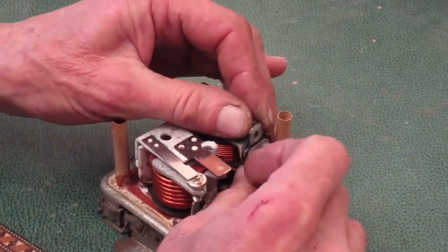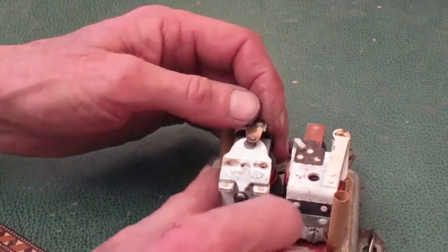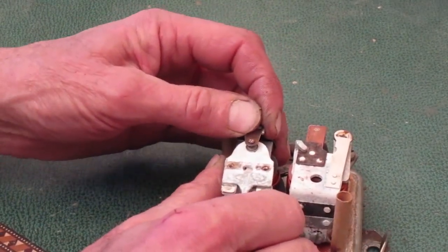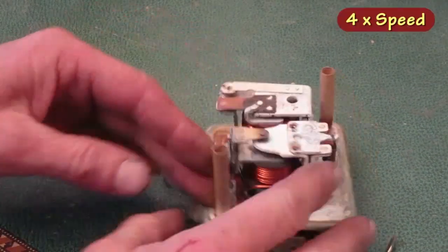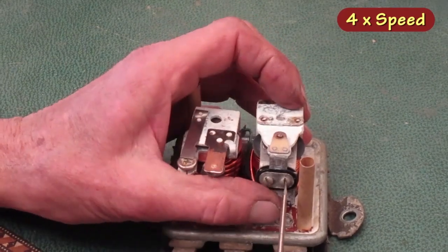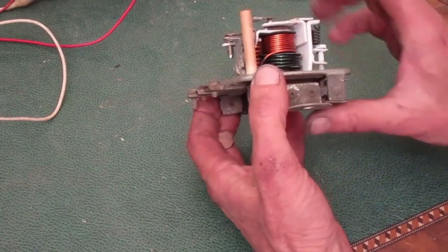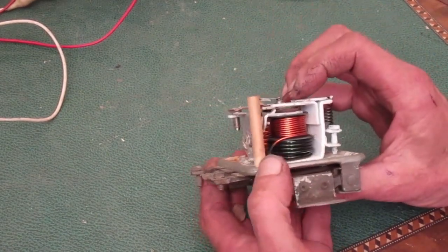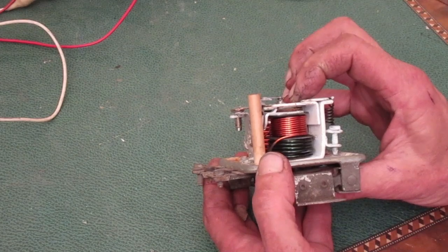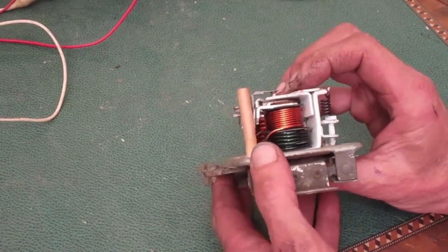This one has slotted mounting holes like the other coil. There's enough room to have it way out of position, so line up the points when you tighten the screws. Now I need to set the gap between the core of the coil and the bottom of this movable point. It should be 75 thousandths of an inch.